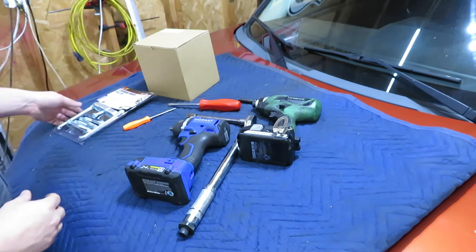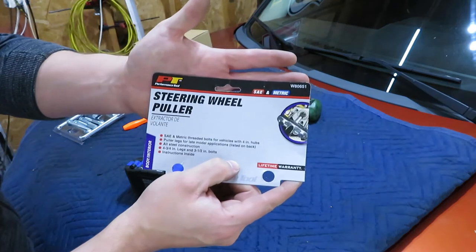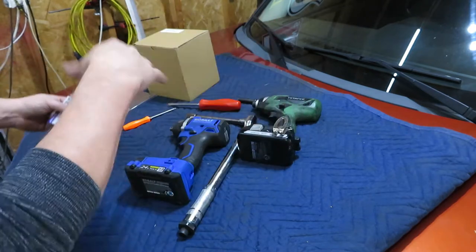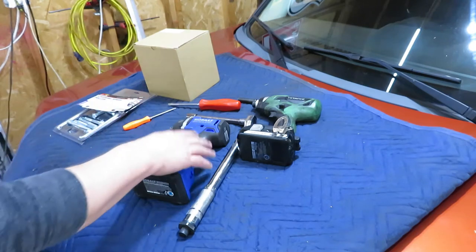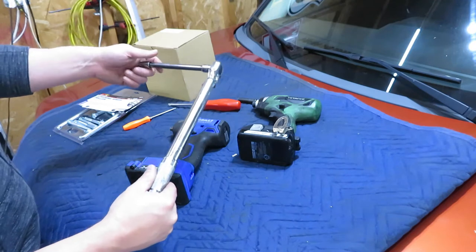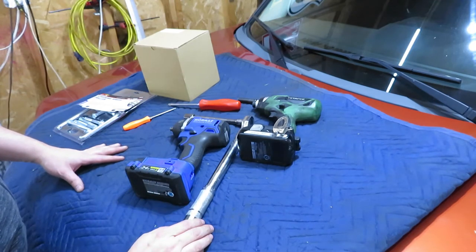And then we've got a steering wheel puller, and this is what I used, and I'll put a link in the description below for all of this. And then you'll also need the replacement clock spring. I used an impact, but you can use a ratchet. And then your torque spec on the steering wheel bolt is 37 foot-pounds.